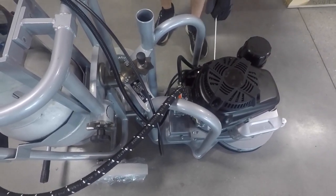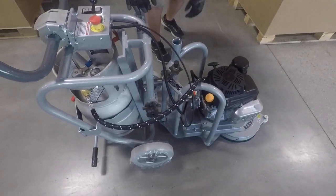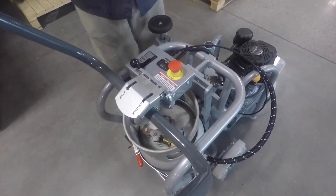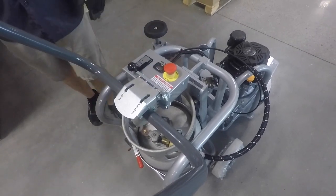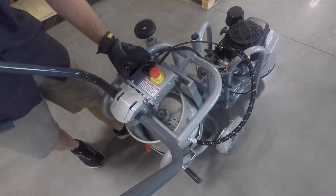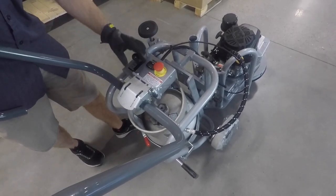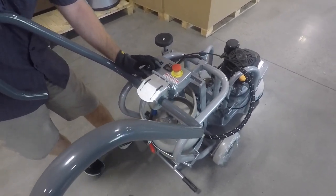Now we're all good — everything's in the starting position, shouldn't take much. Now we're going to go all the way back to idle to prevent it from scratching the floor. This is a centrifugal clutch; if you go at half throttle or full throttle, it will spin the plate down below. I'm going to tilt it back so we don't scratch it up. Running. Bring it down to idle and wait for the plate to stop spinning.